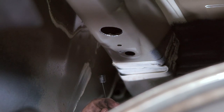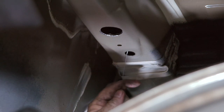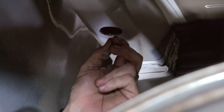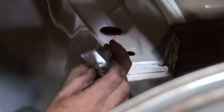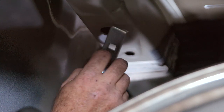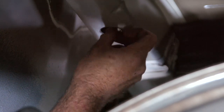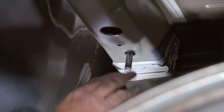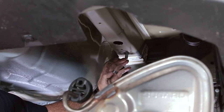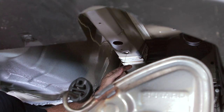Now to get our hardware through the access hole and into our attachment point hole, we're going to take our bolt buddy head and push it through. We're going to take the threads and thread them onto the bolt buddy, then push the spacer up above the bolt, and simply pull. We're going to go ahead and leave the bolt buddy attached to the carriage bolt so that when we put the hitch up in place, if we accidentally push it up into the frame, we don't lose the bolt — we can just simply pull it right back down again.